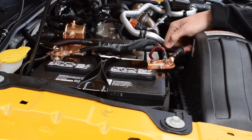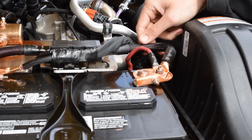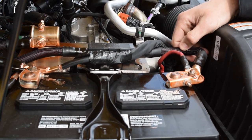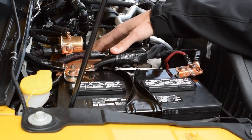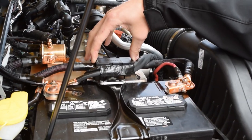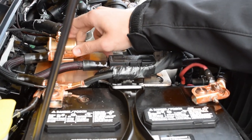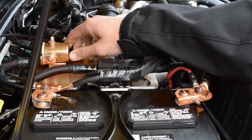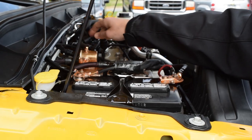I'm going to show you what you get with Rapid Response and our type of wiring. This has a three-aught wire in it, has a custom loom across it, shrink-wrapped on the end with tubing material. Makes it really nice and clean — there's no open split loom for any wire to fall out or ever be exposed. In our fabrication shop we have a nice custom-made aluminum bracket that goes off this post right here to hold the battery in. Inline big inline fuse material goes around into a continuous-use solenoid, which is very important. We see the error a lot where it's actually a starter solenoid, and that cannot be — it has to be a continuous-use solenoid. Real nice clean wiring for the activation wires, which go inside to the cab switching.